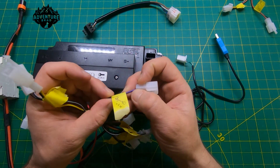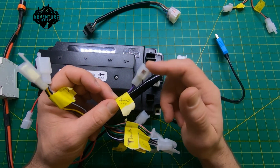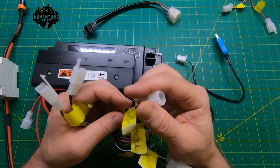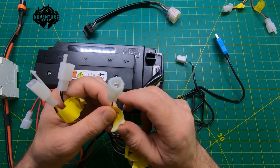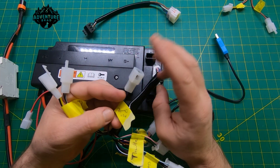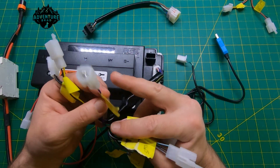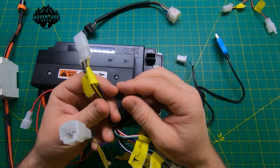Next is the high brake. High brake means a high-voltage reference triggers the brake cutoff to the motor. That's a handy safety feature if you're worried about drivetrain damage or youngsters are driving. For my motorcycle application I could hook it up if needed, but I'll probably have it on an optional switch somewhere.